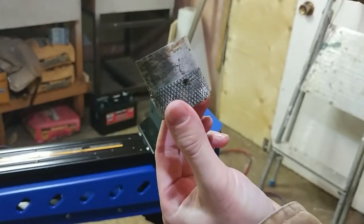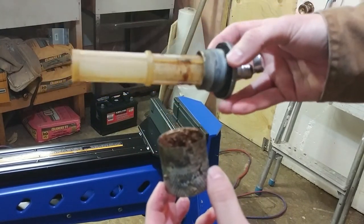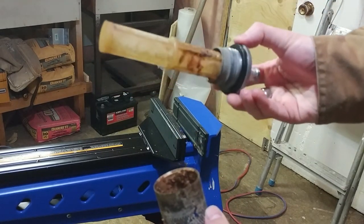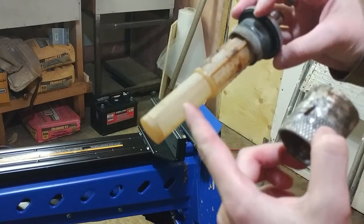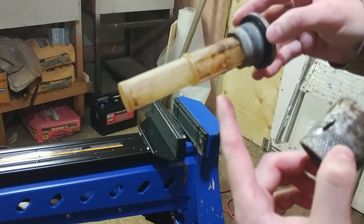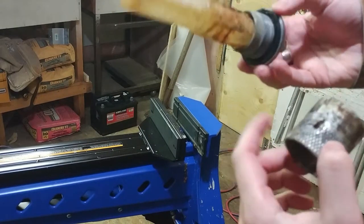So this here is the insert for the gas tank, and here's the strainer I was also trying to retain as it's actually in pretty good shape, just needs to clean up. This is a mesh here — if that had any holes in it then I would indicate it's time to replace that, but since the mesh is in good shape overall I'm going to keep it.